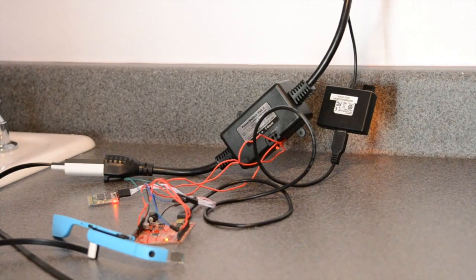When working with Glass, it's important to be mindful of power utilization to prolong the battery life. We have a test rig for this purpose. Glass cycles through functions that we'd like to evaluate for power utilization while monitoring the battery level. Once the battery is drained, it can control its own power socket to charge back up and then discharge to collect another data point.